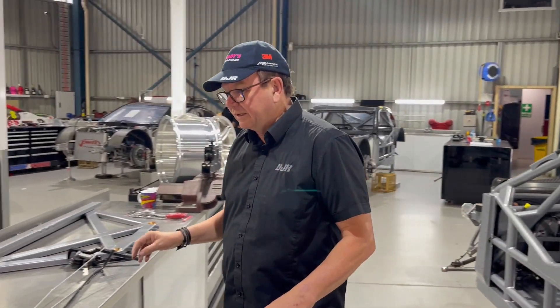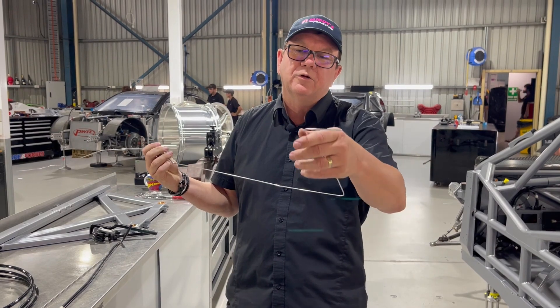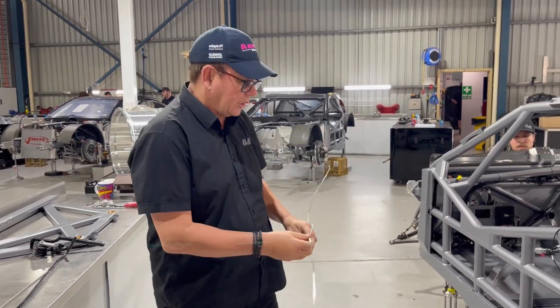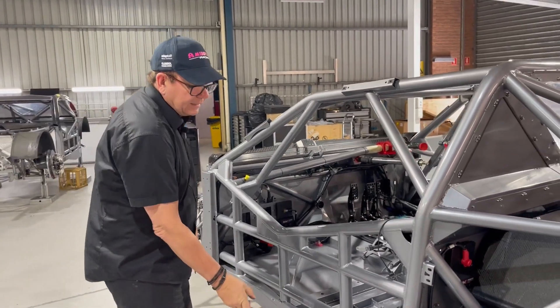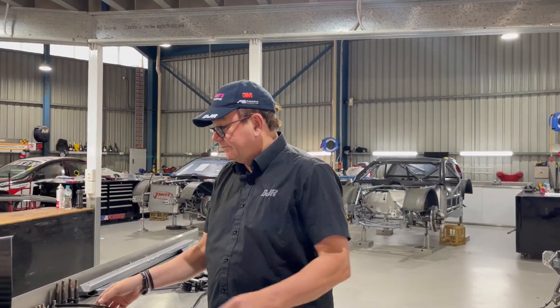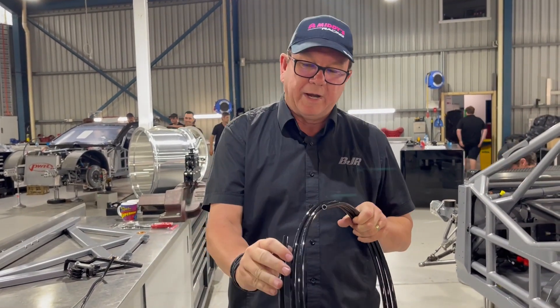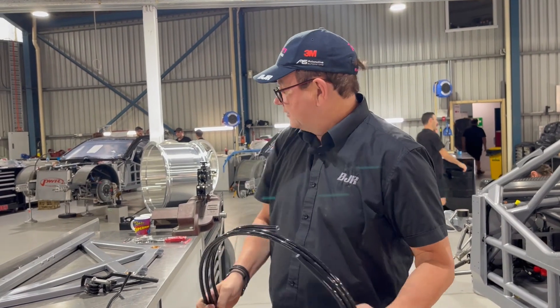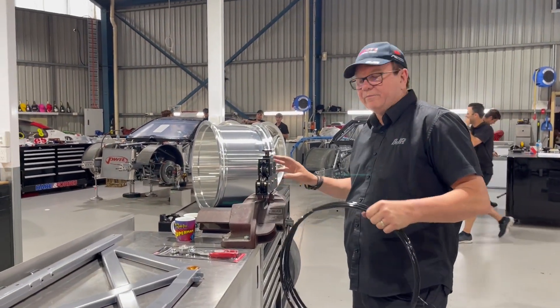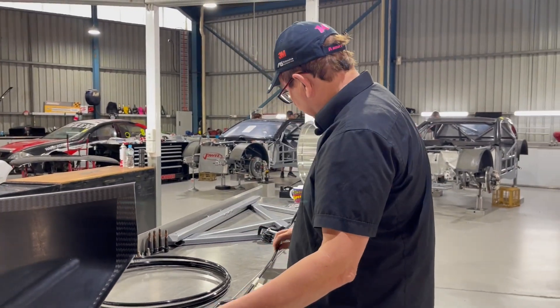If we look at the air jack line, the guys start with welding wire — a straight piece of welding wire — and then they bend it all up, which is easy to bend, to fit the shape they're looking for inside the car. Once this particular part is fitted to the chassis, they know exactly what they want. They then grab some of the pipe we use for the air jacks. Now that comes round like this, so they'll run it through this machine which takes the curve out of it and turns it into something straight.